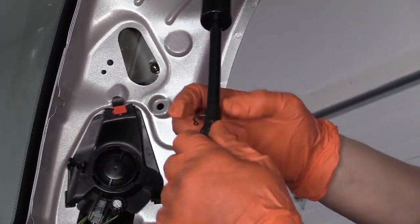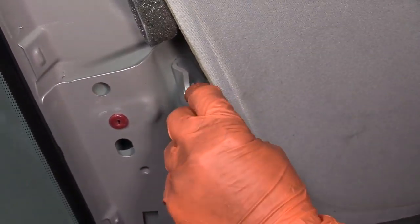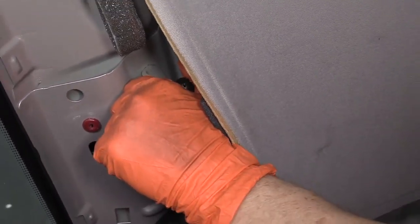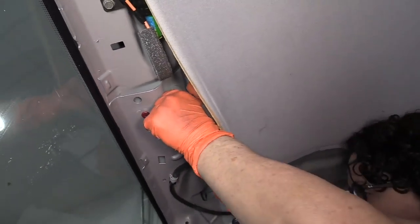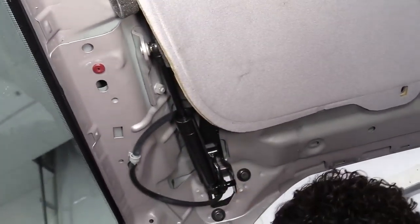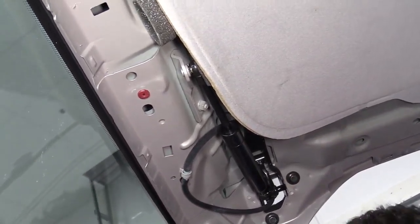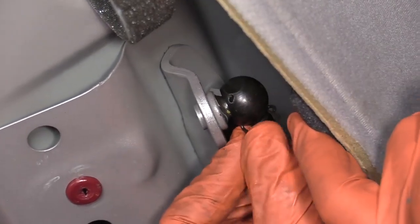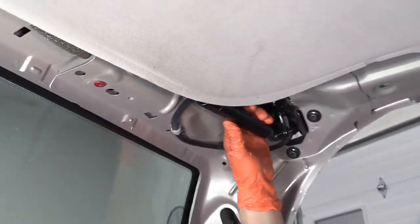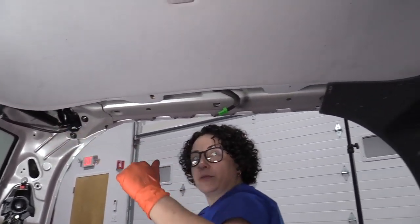So I'm going to remove this one, and now I can spin it and line it up. I can tell that that's a little bit off. I just pushed on the strut a little bit towards the end door, towards the hatch area, and now I can put the clip back in. Much easier when you can see it. Strong arms in. Now you're going to do them in a pair — I strongly recommend — so do the same steps on the other side.